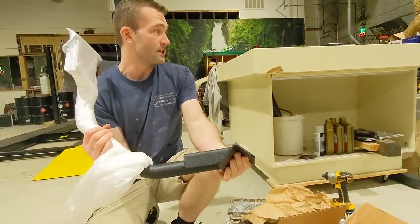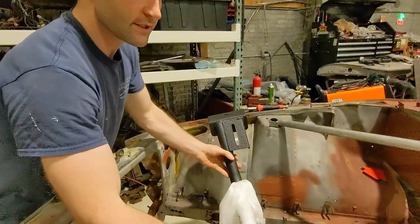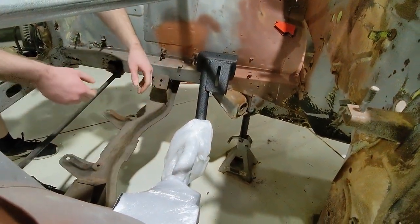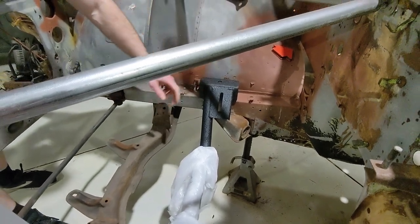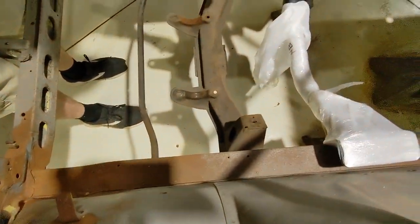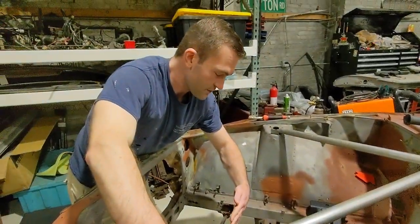And this baby right here, this is what the engine sits on. This is gonna sit across the two engine bay rails. Now I gotta figure out the orientation of whether this is forward or this is forward. Anyway, this is gonna sit somewhere right along there once we get my rails aligned, and bolts go right through. I'm guessing there's probably a backing plate of some kind, or we'll need to make one just to get a good sandwich on the 18 gauge sheet metal that they made the rails out of. And then plenty of adjustment for getting that engine situated however we want.